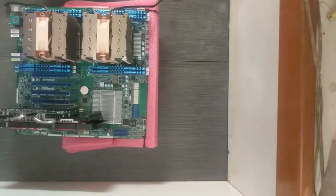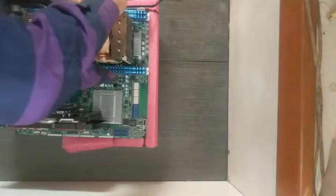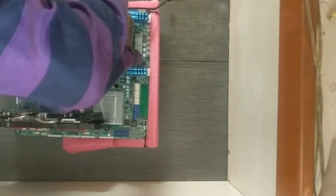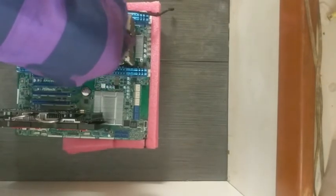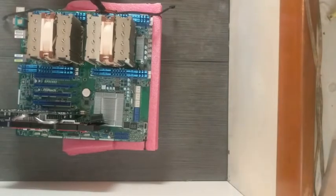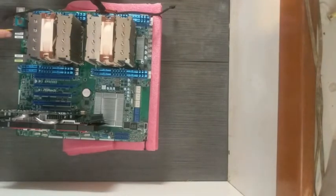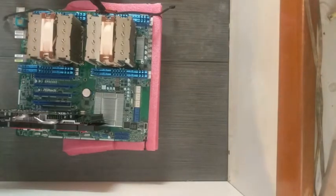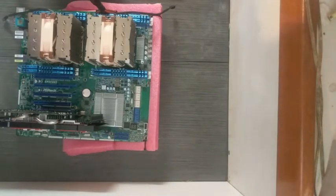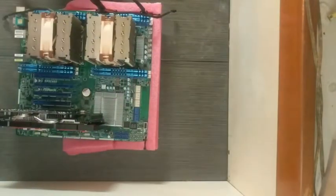First thing is the main power supply to the motherboard. Plugs in so. You'll notice that there's little clips on the side of these. I found when putting these into a motherboard, it is useless to pull back the latch because in the end you want to hear the click. So you'll be releasing the latch anyway. And when you release the latch to hear the click and then you haven't yet done it, well, you'll be pushing down at that point. So. Not that difficult to put it in anyway.